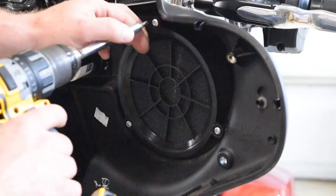According to the diagram, which is over here on the bench, left to right on the plug, you have channel 1 positive, and then channel 1 negative, and then you have a ground. And then you have channel 2 negative, and then channel 2 positive. Okay? Same thing is going to go for 3 and 4 on the second plug also. It's the same exact wiring.